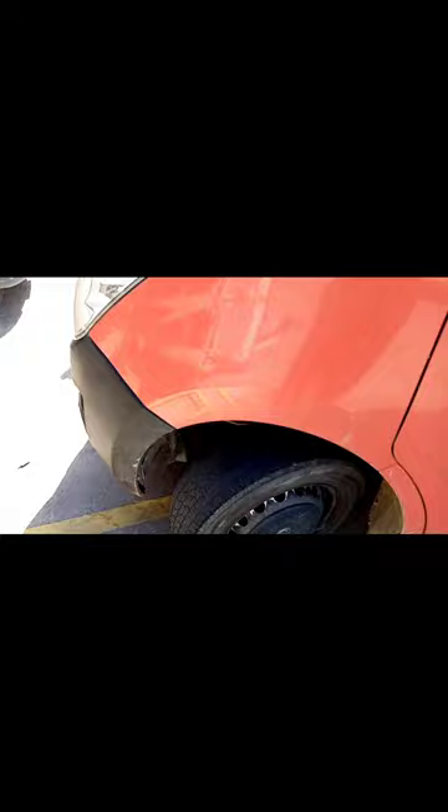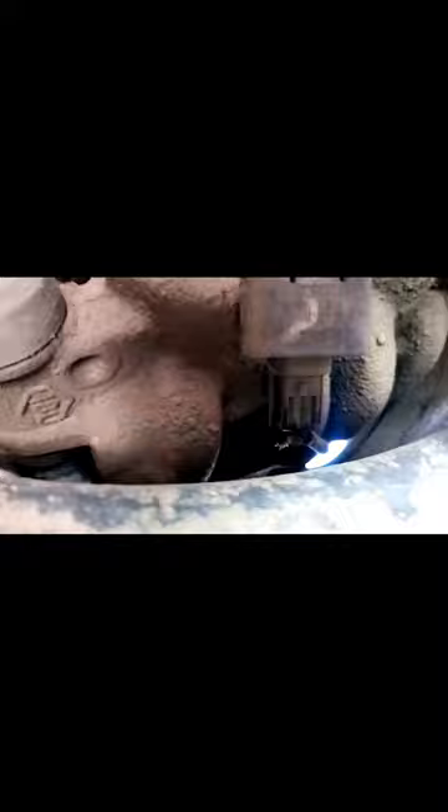Typical when you've got a full day of jobs - he's not here. Hopefully he'll be here in a few minutes. Right, the van's turned up. These have only got one sensor on the front, so before I take the wheels off I've gone straight in there - and you can see that sensor wire, just in there, chopped through on the rim. Someone's left it unclipped and it's just cut that wire on the rim. Easy repair.